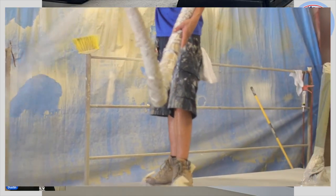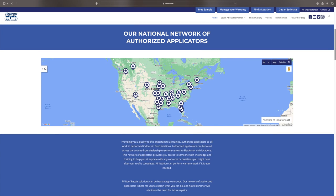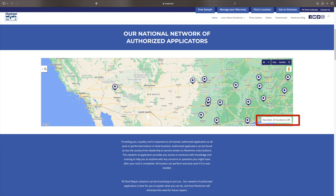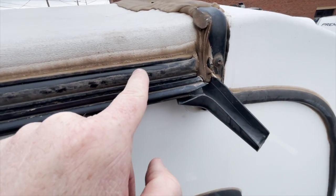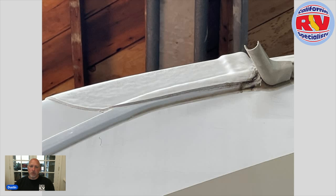Keep in mind that when it comes time to replace the skylight — which, again, is not maintenance-free and does require repairs and replacement as time goes — you are going to have to travel to a very limited number of companies that can repair this. Just like the rear molding, this product has been applied over the cap, the side rail, the front molding, and the rain gutter. If for any reason something needs to be tightened, repaired, or replaced, this coating is now going to be compromised in doing so.